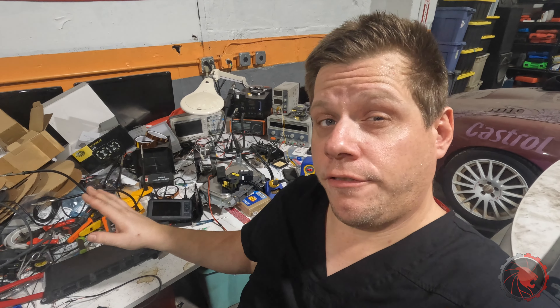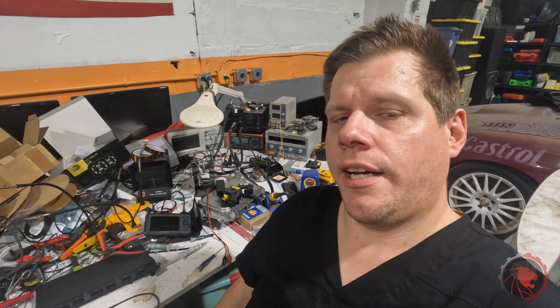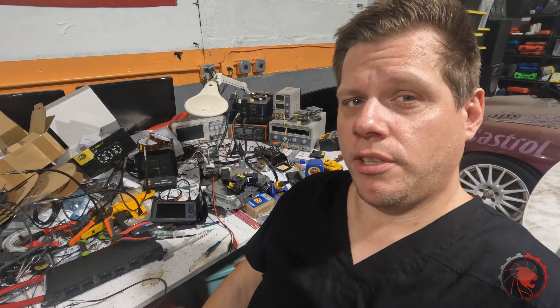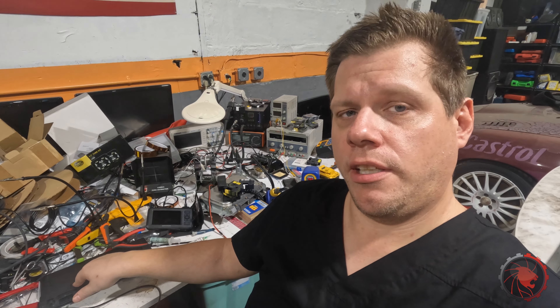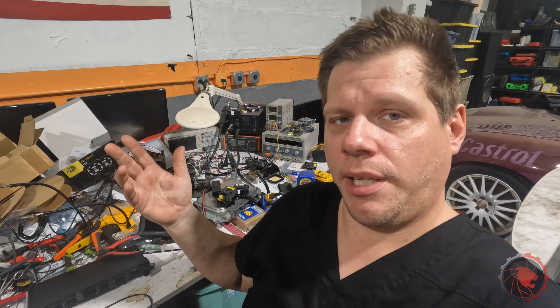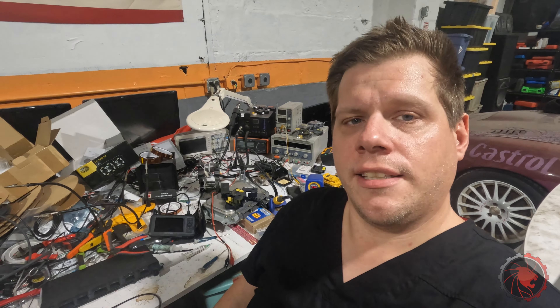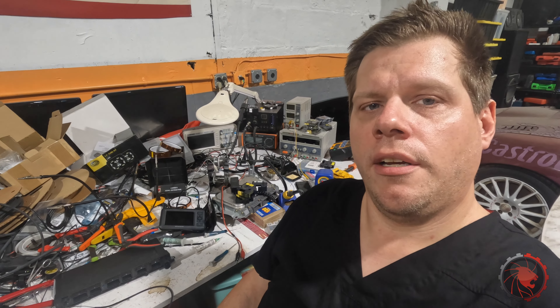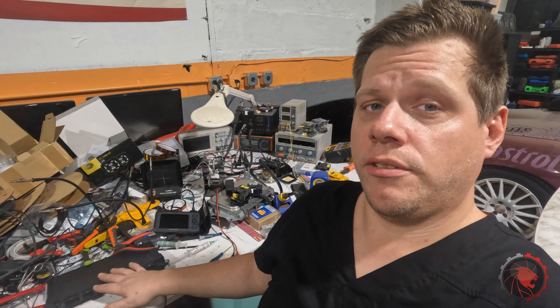All is not lost if you're in the same boat. If you have fairly recent firmware, you can actually talk to the Dominator over CAN bus. You will need Holley's CAN bus dongle — it's about 70 bucks — just a little cable, as Holley's CAN implementation is proprietary. But that does work, and honestly, that's how I personally recommend you talk to the ECU — just leave this garbage USB disconnected unless you absolutely need it, because odds are good you will break one off. That's why there are companies like Motion Raceworks making cable saver brackets for this thing. But honestly, that's a band-aid for a short-sighted design on Holley's part that could very likely bite you. If you're running these ECUs, be careful.